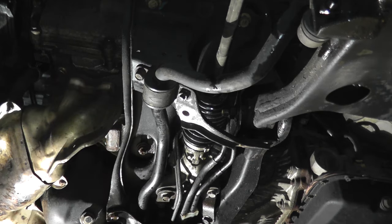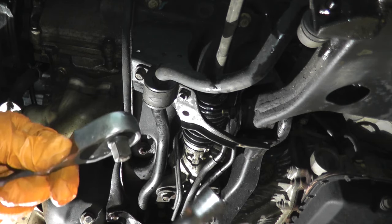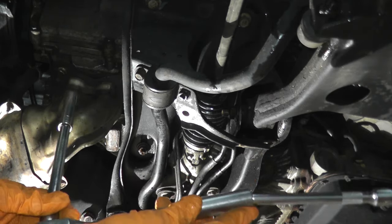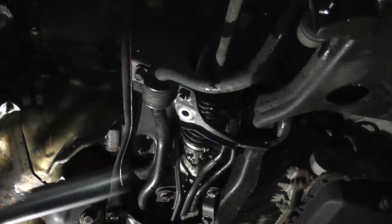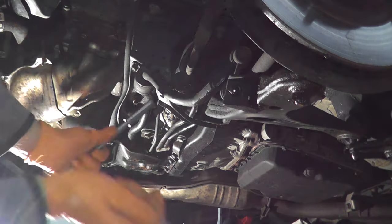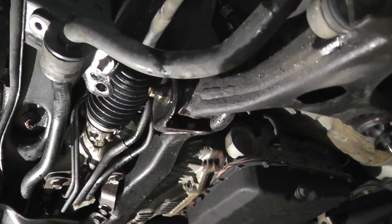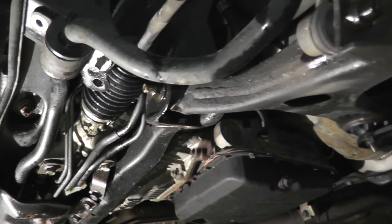Removing these 12mm fasteners — the breaker bar is a half-inch drive. I have a 3/8-inch drive ratchet, and these are really, really tight. To get extra leverage, I'm using an extra socket to fit over the end of the ratchet so I have a much longer handle to break these loose. The whole reason for removing that plate is to get better access to the fastener for the lower control arm. You may be able to leave that plate on, but I prefer to clean things up.